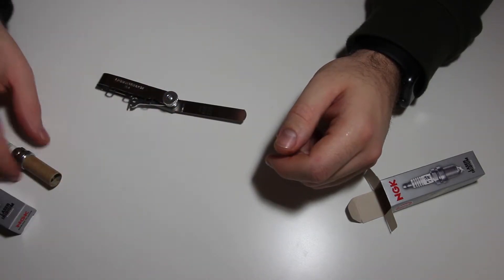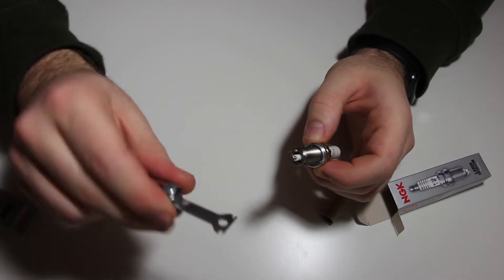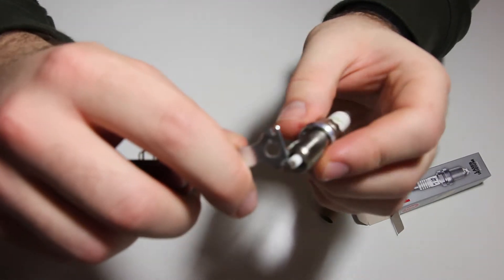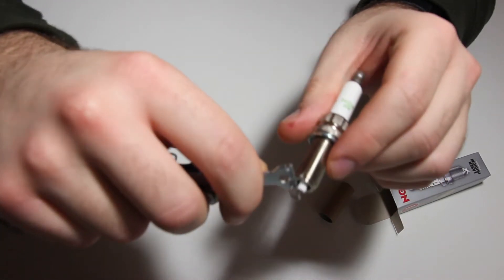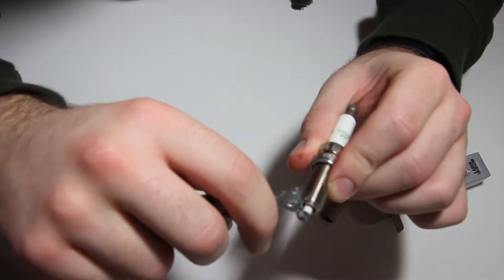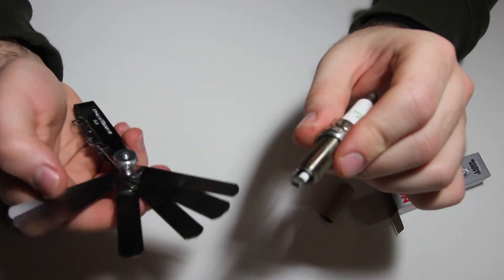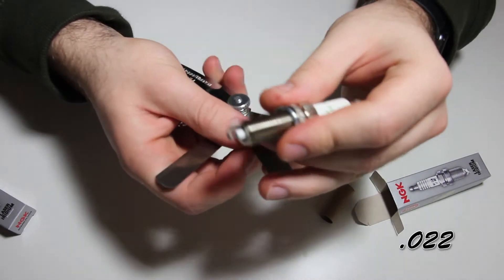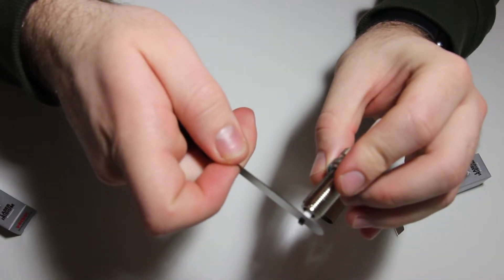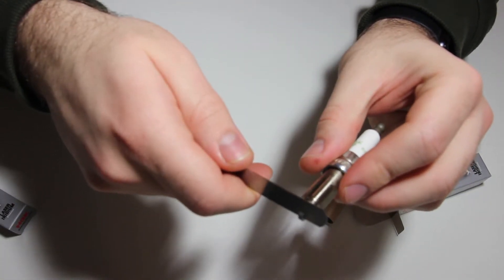What we're going to do is use this tool and bend the tip. You bend it slightly, then go in and find the 0.022. By coincidence, I just did this one perfectly to a 0.022.